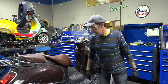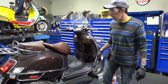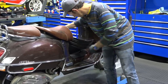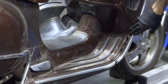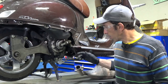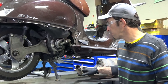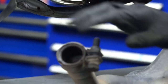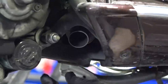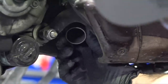I'm going to pull the floor mat up and pull the crash bars off — I'll leave them off because I'm going to put some elbow grease into cleaning all these parts before they go back on the scooter. I've got the right exhaust removed, and the bushing looks pretty good. This is a graphite bushing that isolates vibrations from the muffler and engine from the cylinder head.